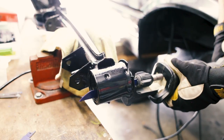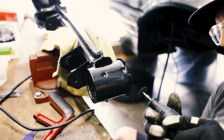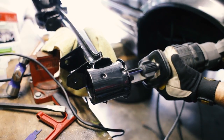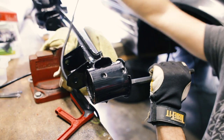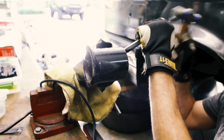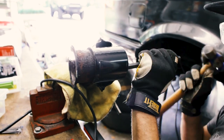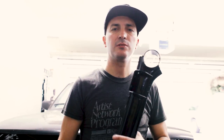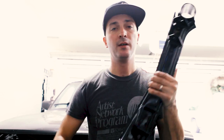Here goes nothing. So we cut that out with a sawzall and then smacked it out with a hammer and punch. Then I used a wire wheel to clean up the inside so it is nice and smooth and ready to accept some beautiful new bushings — keep this car tight, smooth, and handle better. So this is done.